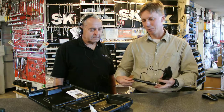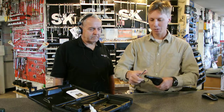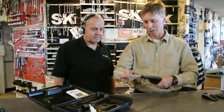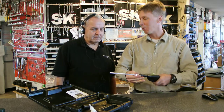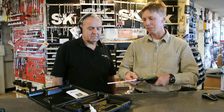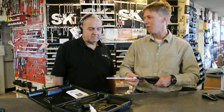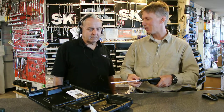Another thing you can do with this tool is find bad components by contact method. This is a little probe that screws into the end of this device and allows you to contact a component that you think may be failing. This isolates engine compartment or other noisy locations from the actual sound of the component being tested. So when you stick your head down somewhere and it's noisy and you're trying to hear through a stethoscope or something like that, it's picking up a lot of ambient noise — this isolates you from that noisy environment and promotes just the signal that you're looking for.